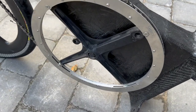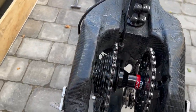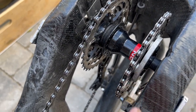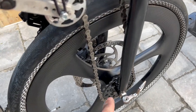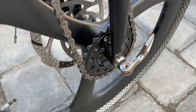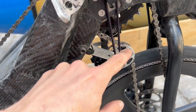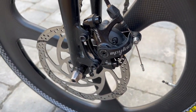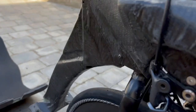You've got an 80-tooth chainring on a standard square taper bottom bracket. The drive goes up to an 11-speed hub that's been reduced to nine speeds. The secondary drive goes down to the front wheel. The front wheel has six-bolt spacing, so a 180mm disc on the far side. This is currently a 24-tooth sprocket and it's going to get reduced to a 17-tooth sprocket at Battle Mountain. There's a sprung chain tensioner up this end, and on this side it's a mechanical disc on a 180mm rotor - all TRP components.